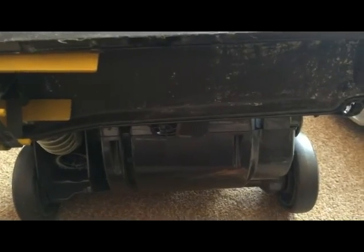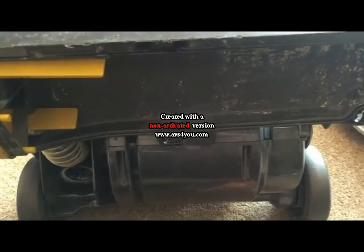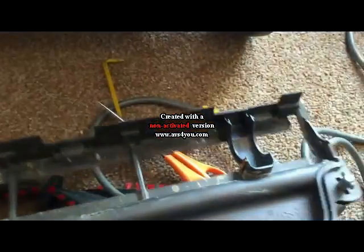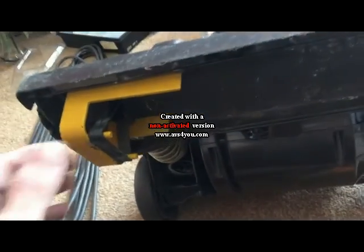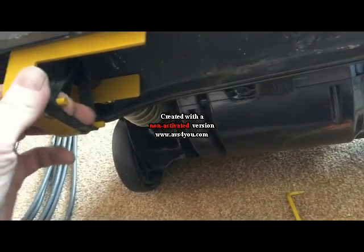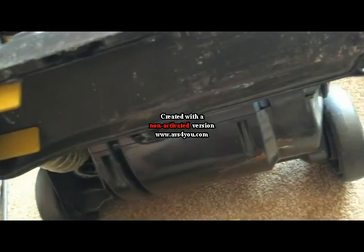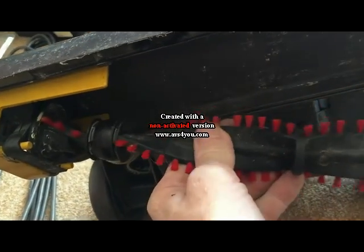Right, once it's all cleaned out, as much as you see fit, obviously you can see a bit of dirt around there, but that doesn't matter so much. It's not going to affect the performance. I've cleaned the brush, I've cleaned the base plate tray as much as I can to get all the loose pieces off. The brush can now go back on, so I've reattached the tool and I've pulled the brush belt out onto those prongs. So now this can just go back.